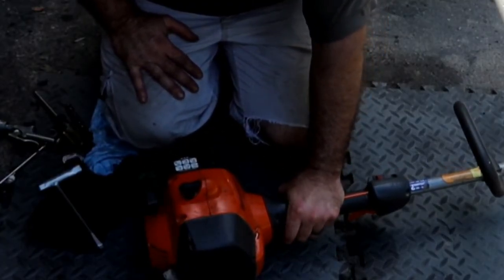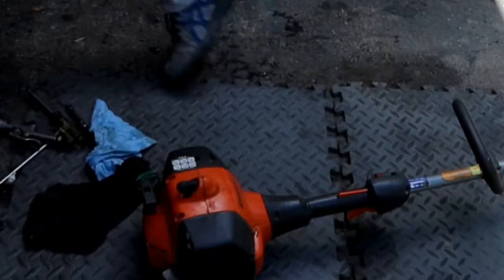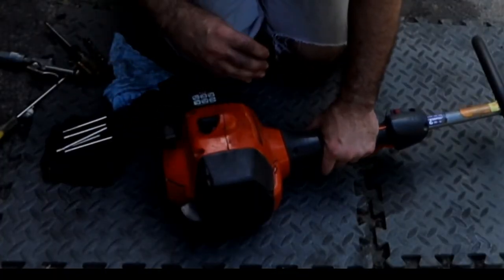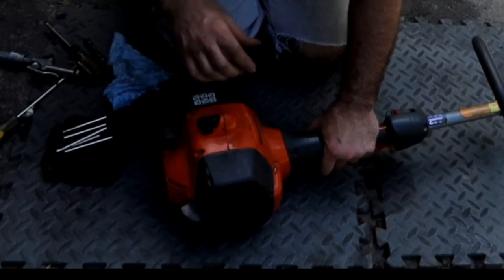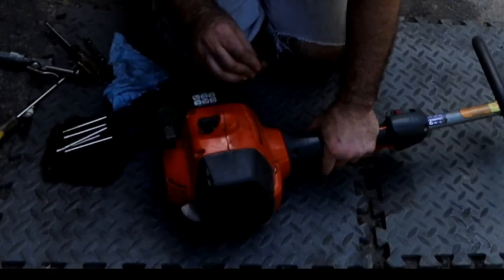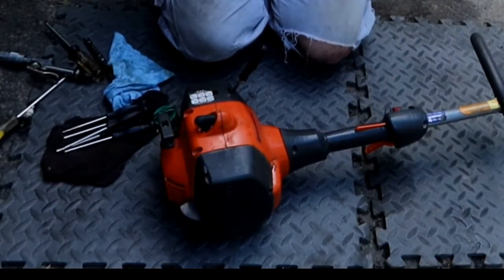So let me go get my carb adjusting screwdrivers. I'll leave a link to those in the description. So most likely it's going to be that one. I'm just looking at the end of the driver itself. Yep, it slides onto the adjuster and it doesn't move too easy. And when I try to move it, I can feel it actually turning. So let's get this fired up and let's get this adjusted.